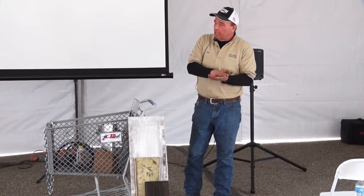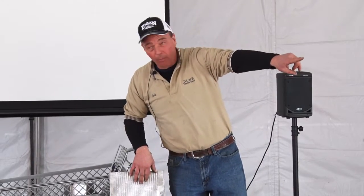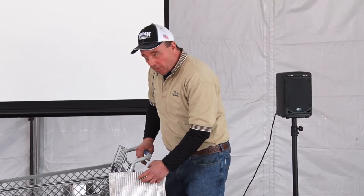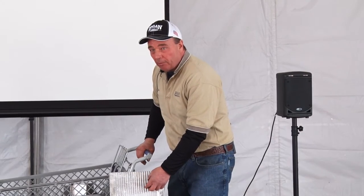The only thing I don't like about that manufacturer, and I'm totally against this on floors, but this is what this manufacturer does, they bedline the aluminum. If you go look at my white pickup truck, I have a bedliner pickup. And once this is coated, I cannot visually see how this floor is doing. So if urine gets underneath there and burned a hole through this, I can't see it unless I'm going around and I'm hammering, trying to find a weak spot.